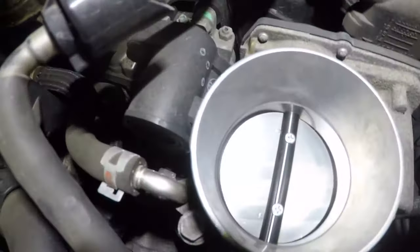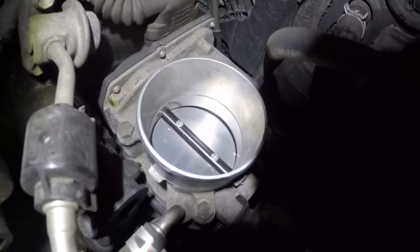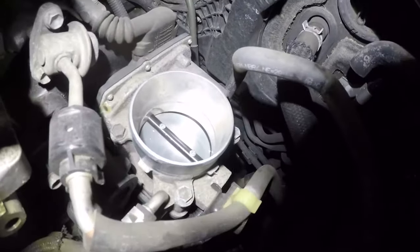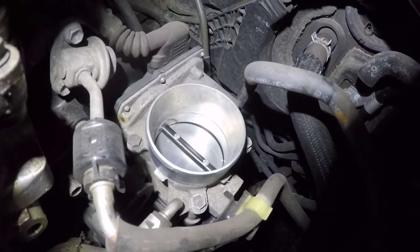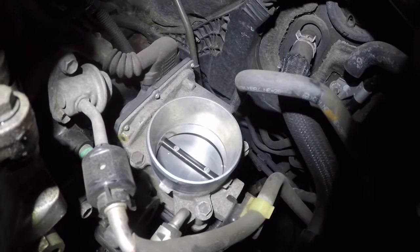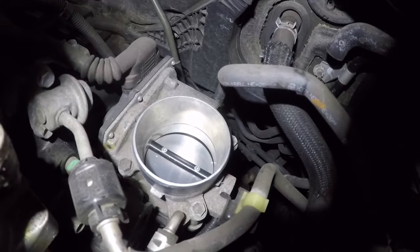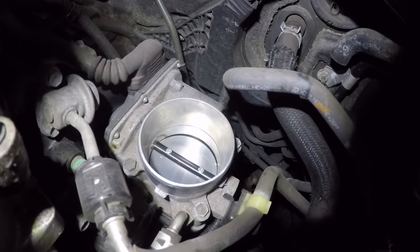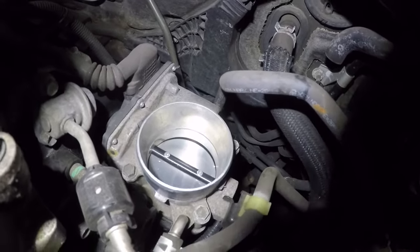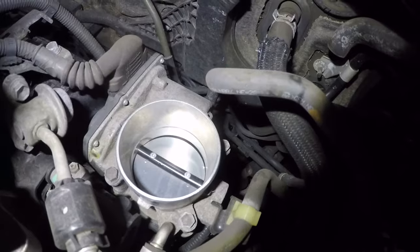So what I'm gonna do is we're gonna gently clean that. A lot of people would tell me I didn't do it right or didn't clean the whole thing. To do the whole thing you'd have to dismantle everything here — you're gonna lose idle, you're gonna have to rebuild the memory, and you'll be in a bigger hole than what you were in. So it's better to clean off as much as you can. I've done it on vehicles and have not had issues in about three to four years. Within three or four years, if you drive 40–50,000 miles, you'll be coming back for the same service. I would recommend you do this every 30,000 miles to keep your idle good.